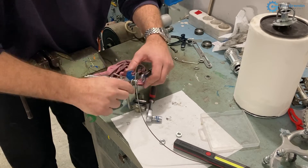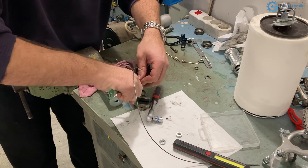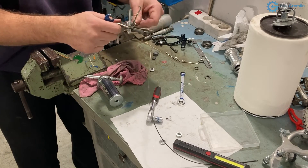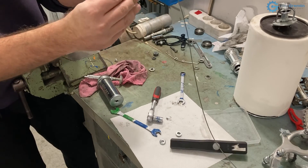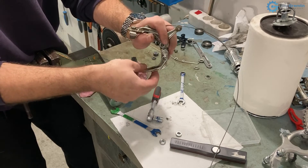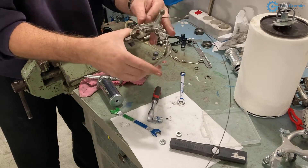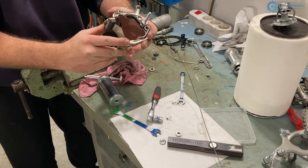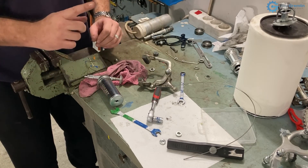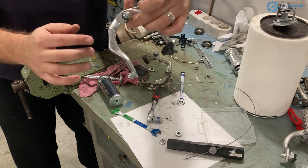It doesn't look bad. As you're tightening, it will be loosened a bit when you press the nut against the lock nut, so I go a touch too tight and then when I screw it in it creates a little more play. It's a back and forth — move by a quarter turn, test again, making sure nothing turns. Once happy, finally tighten to the final torque. Then put the spring in place and test if it works with the spring engaged. I do this without the spring first, then hook it against the brake arms and test if it works nicely. It looked okay.